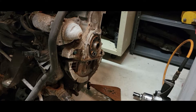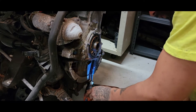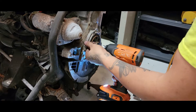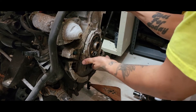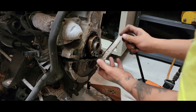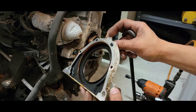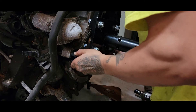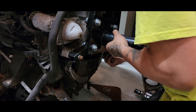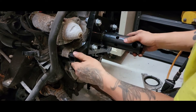I have to take off the rear main seal to be able to get this mount on there, now that I've cut and modified it. I'm just gonna do that real quick. By the way, those three pry points on there — those little tabs — that's what they're for, to pry it off equally so you don't break it.